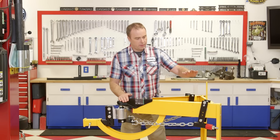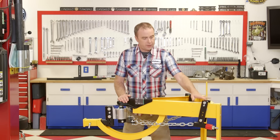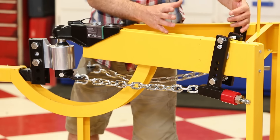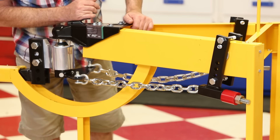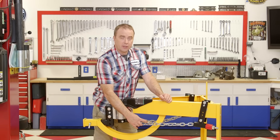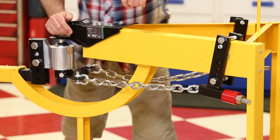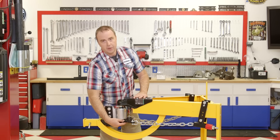Moving back, the brackets come in a couple of different configurations. It fits anything between an A-frame trailer all the way to the pole tongue — a lot more flexibility than most weight distribution systems. If you have something in the way, like a spare tire carrier or a propane tank, you can change the number of links on the chain and move the brackets in or out around that obstruction. When you're ready to disconnect, you can either loosen the nut to take tension off the system, or raise up the trailer with the trailer jack and pop the plate off. All in all, just a really innovative and unique system — relatively inexpensive — and one that we have a lot of confidence in.